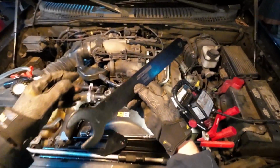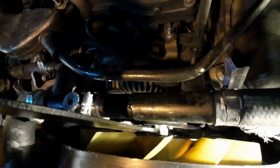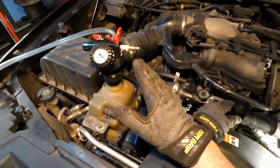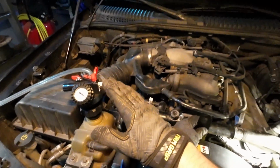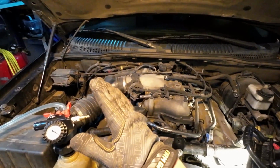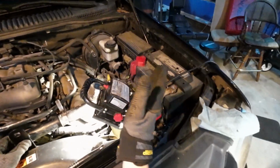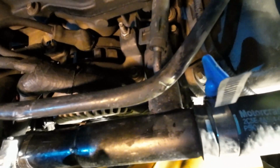Okay, as we place the forward fan clutch wrench on the fan clutch, I'm not going to want this vertically. I want to position it this way so I have as much free space for that breaker bar to turn clockwise before it is interfered by hitting something. So I will turn this way to plan ahead, and we'll notice the pulley will spin because that specialty tool is not supporting it.